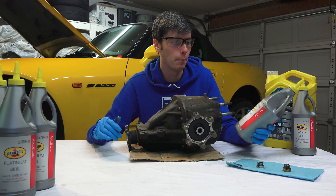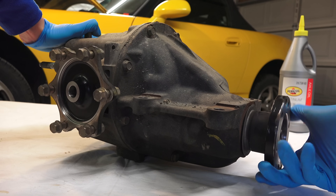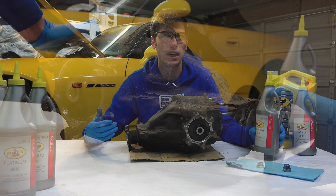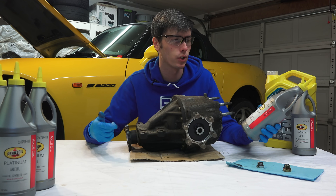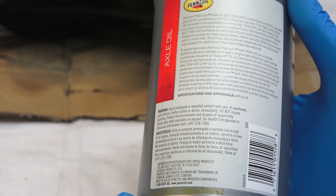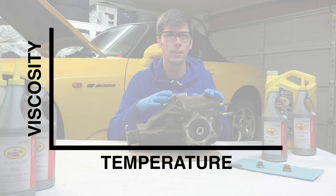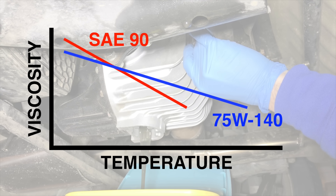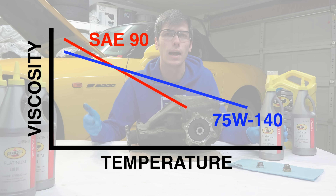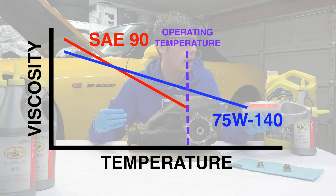This differential has been built for a bit more power, and if you're going to be putting more power through it — for example, taking it to track days or autocross — a thicker oil can help protect it more. It will cause slightly worse fuel economy and won't be as efficient, but assuming you get good flow, that thicker oil allows for more protection. The logic is: more power means more heat into the differential. The hotter an oil gets, the lower its viscosity becomes. So if you start with a thicker viscosity grade, it can reach higher temperatures and still act like the original oil grade would at a lower temperature.